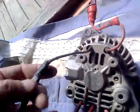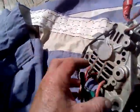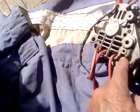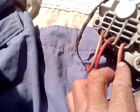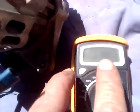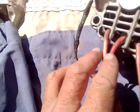Anyway, you put power in through the 2 slip rings here, right? 12 volts into the 2 slip rings, which powers up the very center of these alternators. Now, in my next video, I'm going to measure from the 3 poles coming out. It may not be this one now that I know that. It may be another one. But I'm going to show you how you can work out what the voltage is in AC coming out of 3 pins.